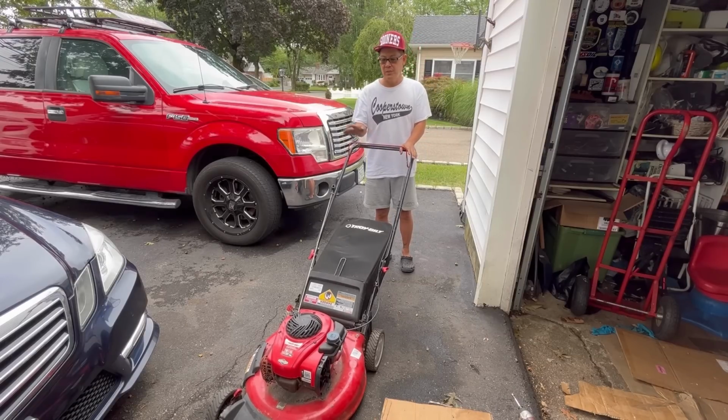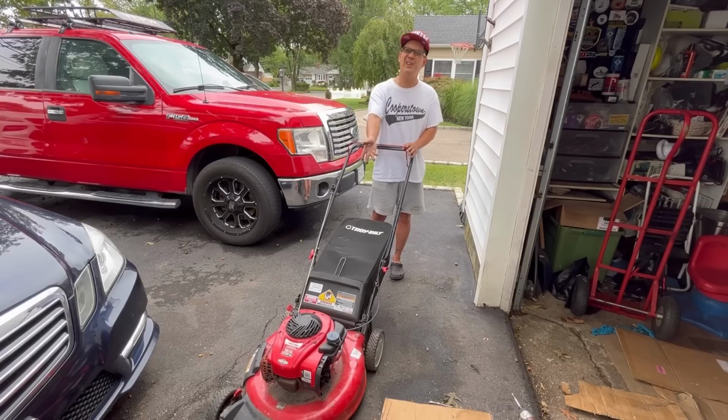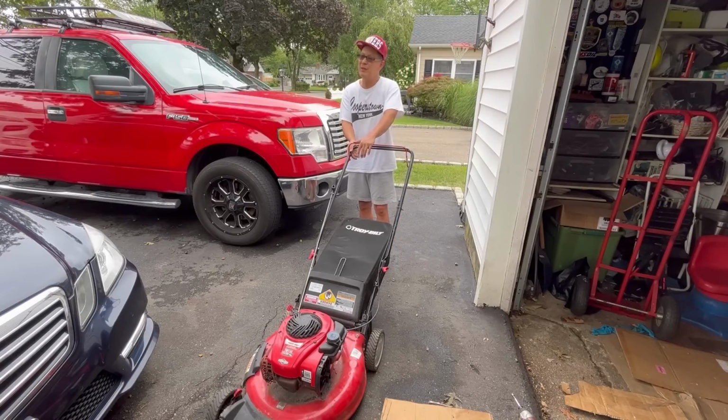So with Toro-type machines, typically you need to put really good gas in it. More like their snow blowers. Their snow blowers are made by LCT engines, or their engines require at least 91 octane, believe it or not. And you're gonna think I'm nuts, but I've cleaned the carburetor for one of those things like 5 times and it still surged. And the minute we put 91 gas in there, it ran so smooth. So this is bad gas in here. Yes, it is a Briggs engine. Shouldn't make too much of a difference, but the gas didn't look terrible, but it's definitely old because it turned yellow.